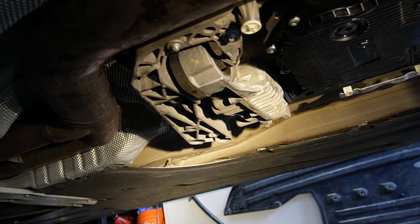Particularly, this is its cross member. For this video's sake, I'll be removing the cross member simply because you will have a better visual of what's going on when I'm extracting the old fluid as well as refilling the system with new fluid. Realistically speaking, if you have a short allen key that's 14mm, you don't necessarily have to remove the cross member, but it will be easier to access everything you need to do. Since this cross member holds the weight of the transfer case and transmission, you will want to jack it up ever so slightly.